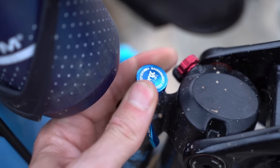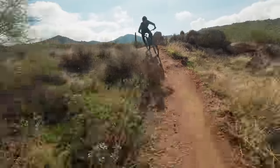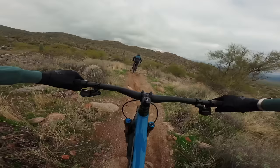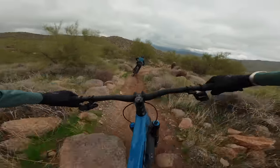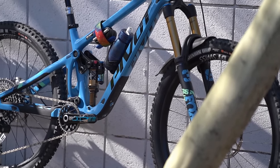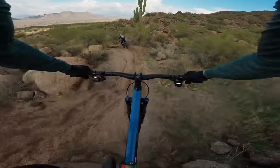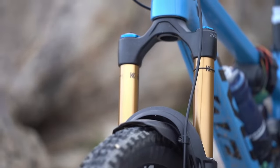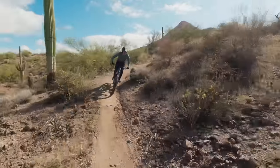The Float X has felt great from the get-go with a fairly neutral tune — I haven't needed to touch either the air pressure or rebound damping after initial setup. The blue low-speed compression dial has been useful for adjusting the bike's attitude to suit different trail conditions. On steeper, flowier terrain I opened up the compression damping to let the shock sit a little lower in its travel; on rockier trails I set the dial about halfway to add more support and lift the ride height. In both scenarios the back end has felt really smooth and controlled, with great support and a 0.5 volume spacer offering tuning options in either direction. Combined with a longer wheelbase, the top-notch suspension really does close the gap on the bigger-travel Firebird.